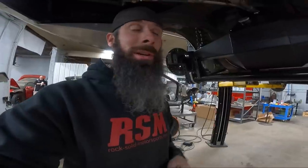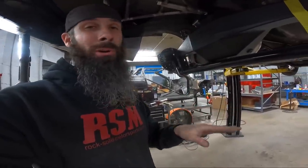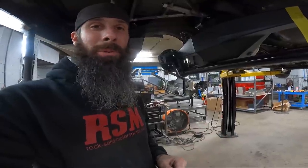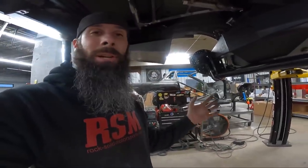We also have some adjustable lower control arm boxes that are going to weld up in the front. Matt from Tick actually came by — this is something he designed for his own personal car which is a third-gen Camaro — and we're going to incorporate it into Grub Worm since the underside of these chassis are pretty much the same. We're going to be cutting those in, and I'll probably talk about that on the next video update. That's going to give us a lot more adjustment up front, because with the car being lowered the lower control arm bar angle is going to have to go up even further, otherwise it defeats the purpose of lowering the car — you lose your bar angle.